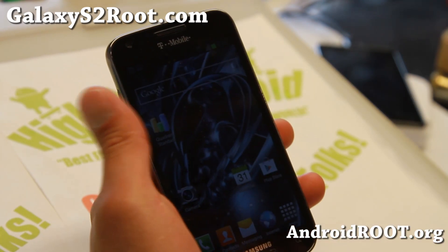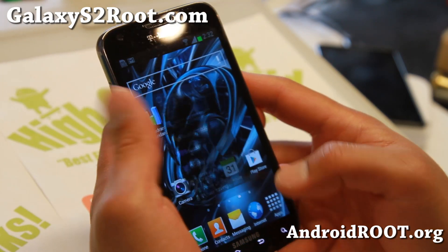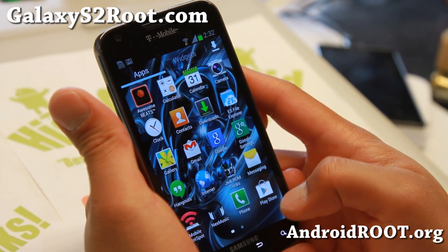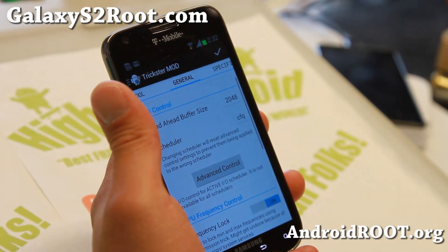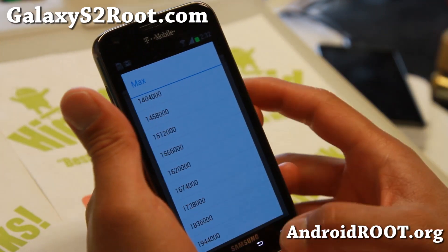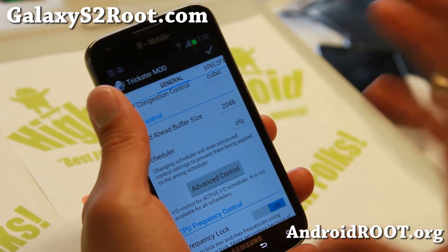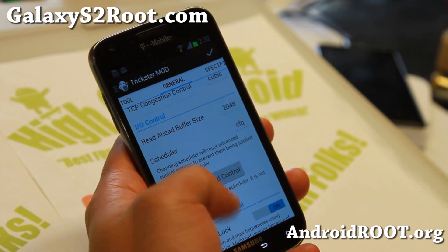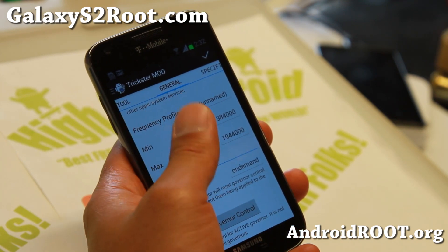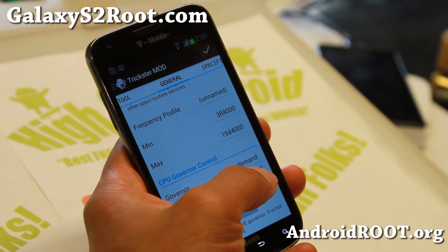But for those of you who don't know, the latest version comes with a brand new kernel called Jedi Kernel Z, which is a major upgrade. You can use Trickster Mod here and overclock it to 1.944 GHz, actually being able to run at that high frequency for a couple hours, pretty stable even at 1.944 GHz. This kernel also uses hotplug, which shuts off cores when we're not using them, so it should give you that extra overclocking while also saving you better battery life.